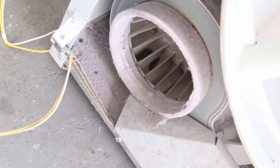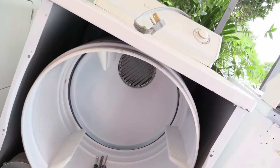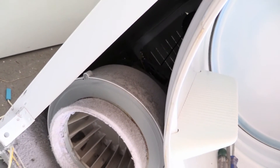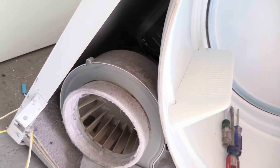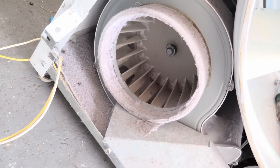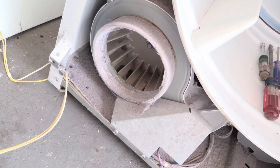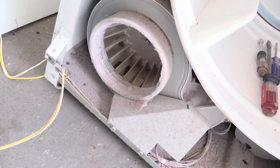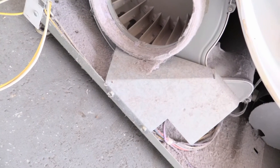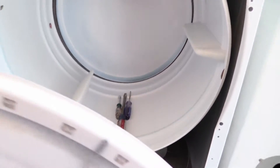That tells me that's sucking, and that's probably a good thing, because theoretically all I would have to do is cut a circular hole in the back of this whole thing and it will just suck everything out. Something else interesting — I'll take this the rest of the way apart in a moment — but back in there is the electric motor, and the question is whether it's brushless or brushed so it won't ignite the fumes. But this is a squirrel cage running independently — not like a desk fan where the air blows straight through the motor. This is separate, so as long as you can keep the motors separate from this squirrel cage, it doesn't matter. I'm going to take this apart the rest of the way and get a really good look at that.